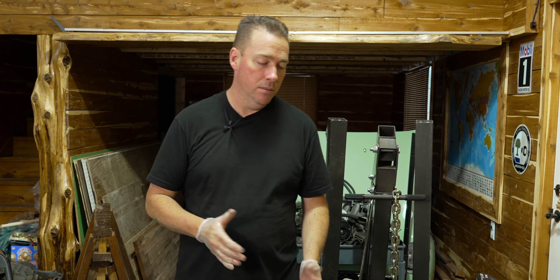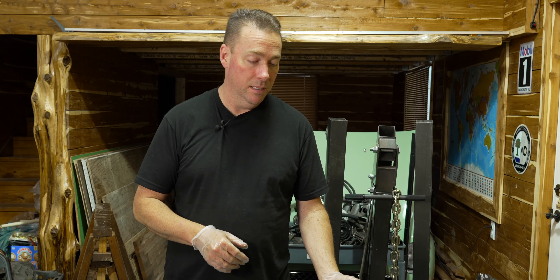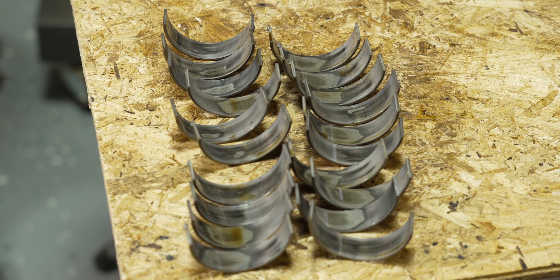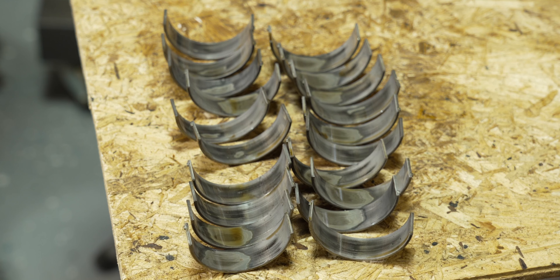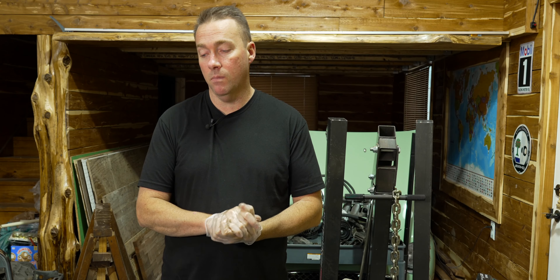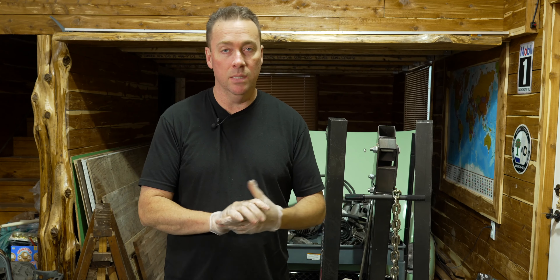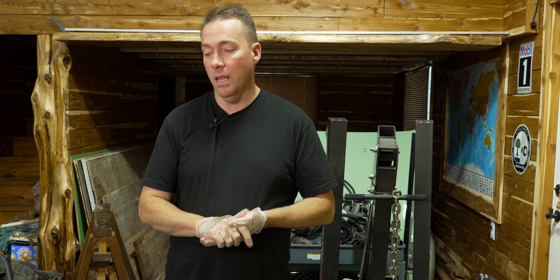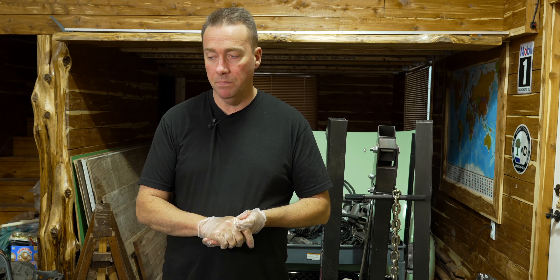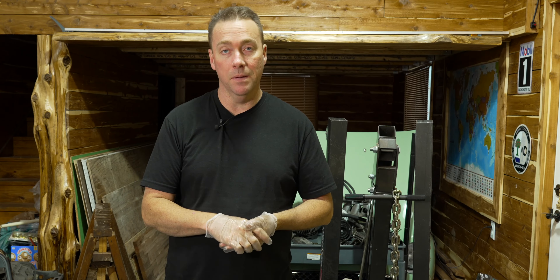Phil's going to put the camera on time-lapse and we're going to go down the line and do the other nine. Then we're going to stack in the oil pump and the VANOS pump. We dealt with all the rod bearings without any issue - none of them are very bad at all. Everything looked really good, no copper showing on any of them, everything really smooth. Now we're going to reinstall both oil pumps and set with our caliper the lash for the VANOS oil pump, put a new O-ring gasket on, and reassemble.